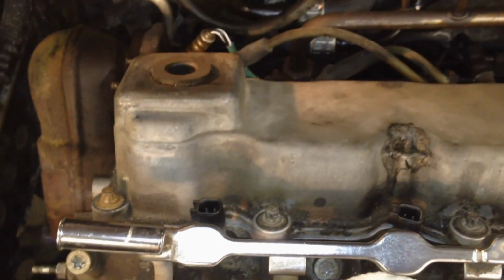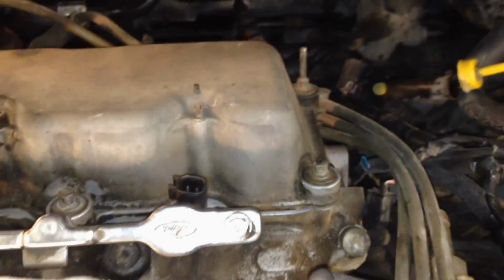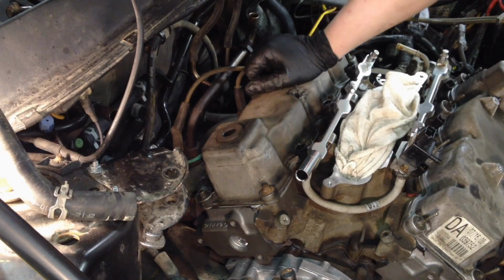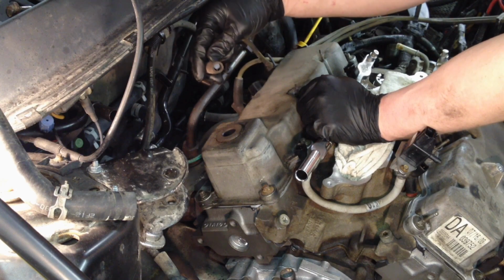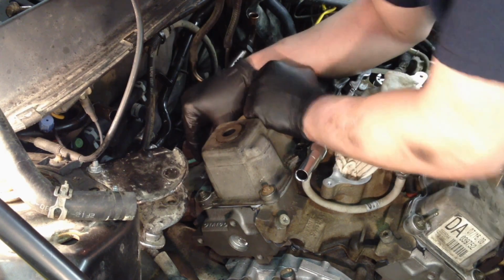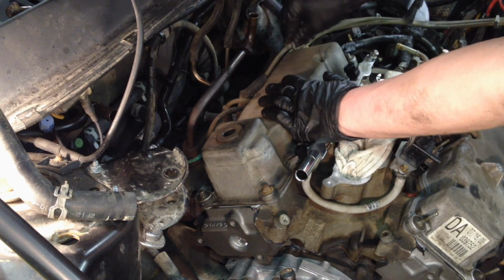Now, in case you got it mixed up, the rear valve cover is not all studs like the front. So there's 2 studs for the rear, and they go right here, one there, and that's for the spark plug wires. Alright, so speaking of spark plug wires, you might as well put them in now. Put a little bit of dielectric grease on them and connect them all up while we got free access. You can clip it into our valve cover too at those 2 points.